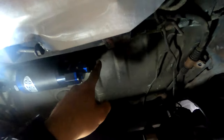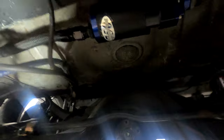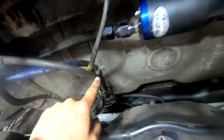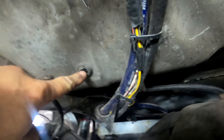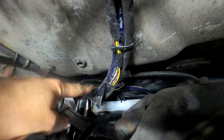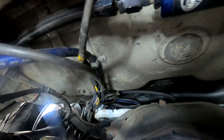I've also rerouted this fuel line — that's the outlet obviously — and I've got new fuel line that's going to loop around and then make its way to the pickup and pre-filter. As far as the wiring goes, I'm going to follow this wiring and plug in here, then follow it back to the battery in the rear corner and tape it up nice in this loom of wires.